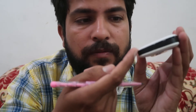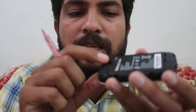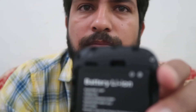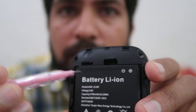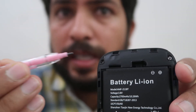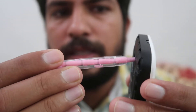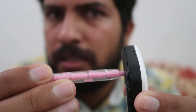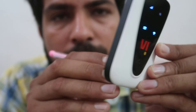First, check the cover on the device — you'll find a latch and you have to remove this cover. After removing it, you will see a big hole on the battery side area where a button is located inside. You need a needle, pen, or SIM ejector tool to press it. When you press it, you'll hear a 'tak tak' sound, meaning it's pressing correctly.